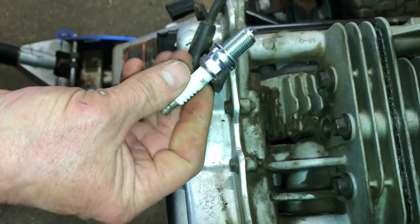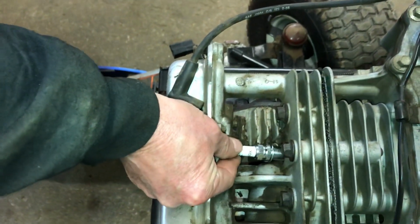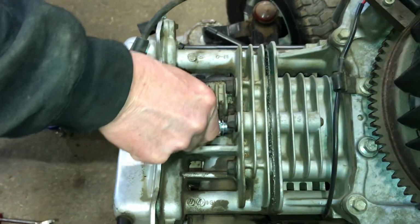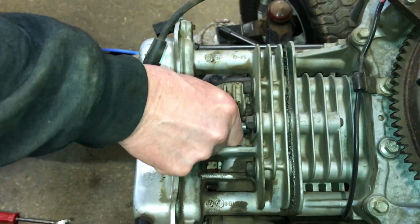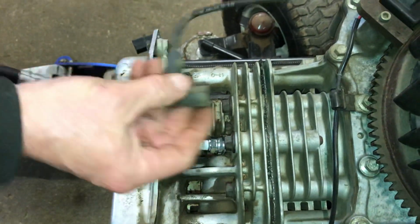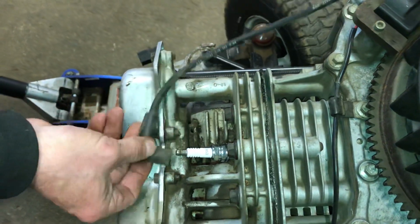These come pre-gapped already. 30 thousandths is what you want to use, but an RC12YC Champion you can also use. And it makes it so much easier to work on the spark plug just by taking those 4 bolts out and the housing off, and then you can work on everything else, because this is the coil wire. Here's your coil if you need to get to your coil. It's just very nice. But thanks for watching.